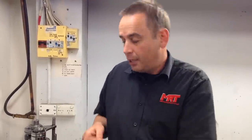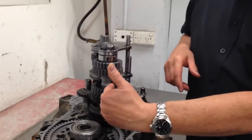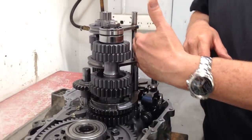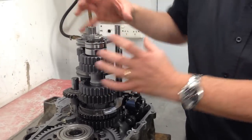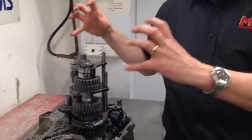At the end of the day, if you want the best performance and outcome, the strength of the gear set is determined by the shape of the gear and the way the dogs are cut. One last thing I wanted to point out: a straight-cut gearbox transfers the load straight through the gears. If it's got a helical gear set, the gears are always fighting to push themselves apart, so you end up with a lot more load of the gear sets trying to expand out inside the gearbox housing itself. I'll show you some photos on the link at the bottom of this video, and I hope today this has helped you understand a little bit more about what a gearbox works like inside your car and the difference between the options you can find all around the world.